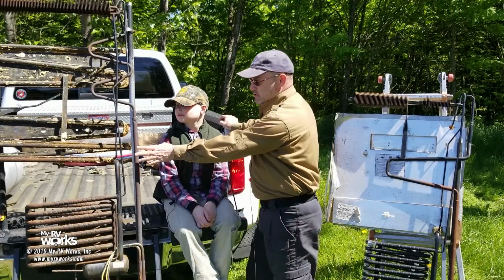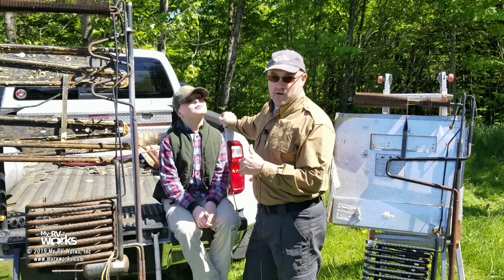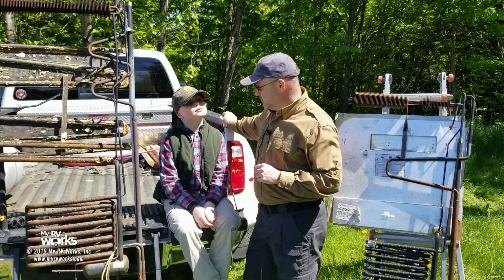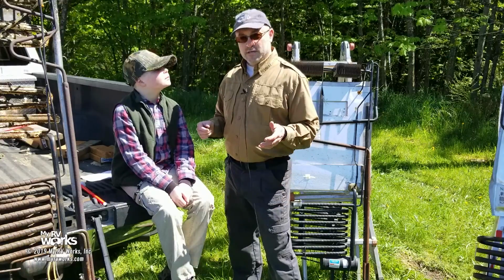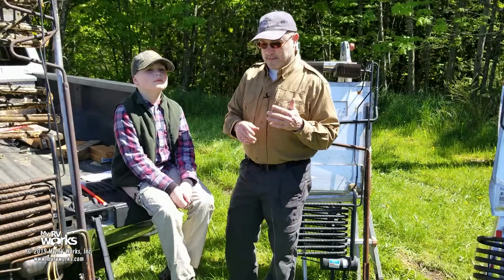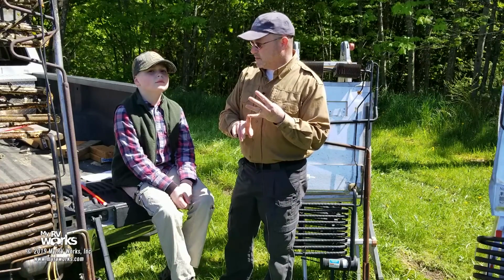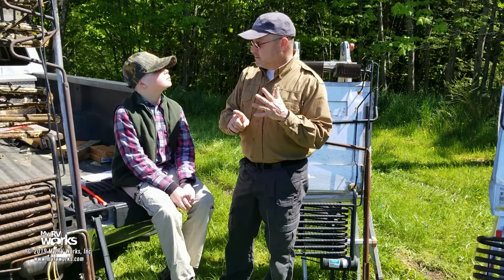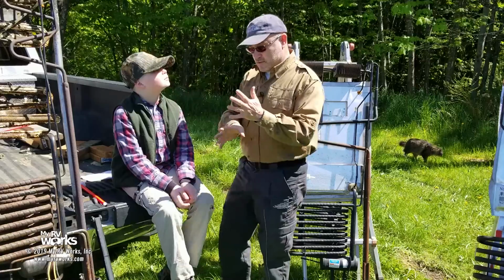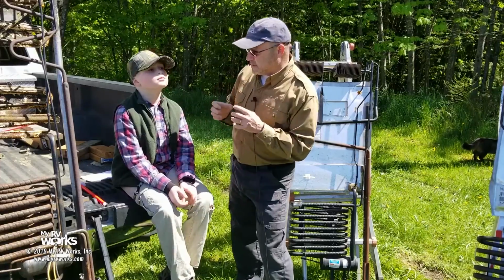We're going to move the camera closer to the cooling unit here and start pointing out some of the features and explain how these cooling units actually cool with heat. You ready? Okay, so if ammonia is the main character of our ensemble, there are several other supporting members of that ammonia. And there's going to be ammonia in this, hydrogen, distilled water, sodium chromate, heat, pressure, gravity, levelness, and venting. I think I've got a lot of that covered. So those are all the supporting cast members to make the ammonia work. It's really the story of ammonia. Ammonia is the magic ingredient that makes this work.